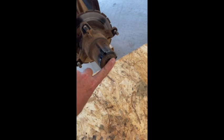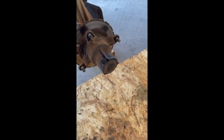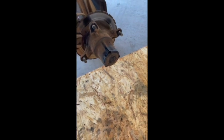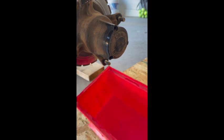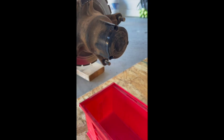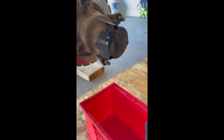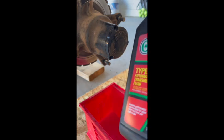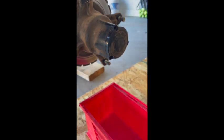I want to keep the fluid because I just put new fluid in there recently and I can reuse it. I've got my catch pan here, and I know I probably shouldn't reuse the fluid no matter what, so I've got more. This is Type F automatic transmission fluid, and according to most forums I read, this can be used as an alternative to the demand drive fluid sold by Polaris. It seems to work pretty good.